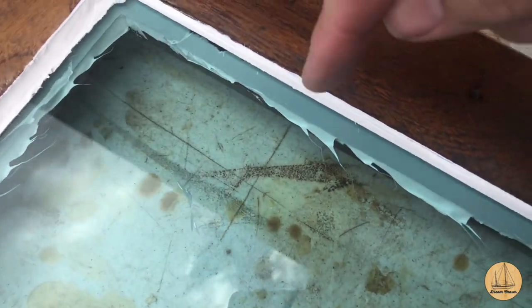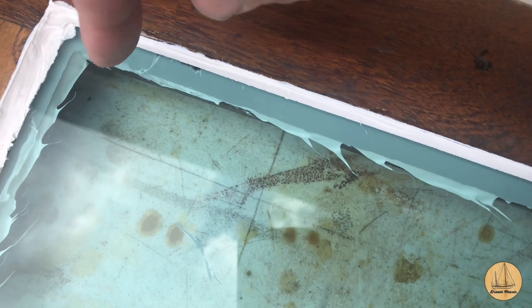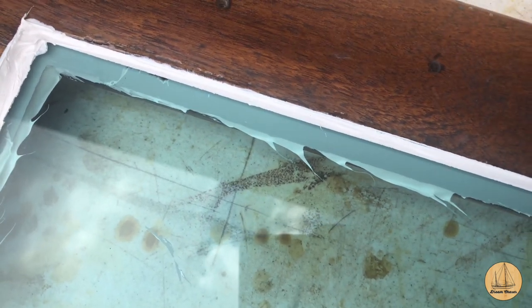You can see though, underneath the glass, it gummed up there. I got a little set of love bugs right below the glass. Anyway, you can see where I'll have to trim underneath that caulk once it hardens. I'll just trim that with a razor. And the reason I'm going to trim it with a razor after it hardens is I don't want to stretch the material or try and reshape it and potentially pull some of it out of the joint. What I'd rather do is leave it in there, have a nice good solid adhesion and sealant, and then I can come back with the razor blade and just make a nice straight edge with it. It'll look fine that way. Looks really horrendous right now, but in 3 hours I'll be able to take the blade and smooth that right out.